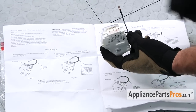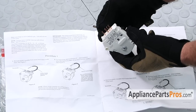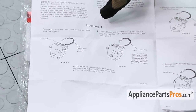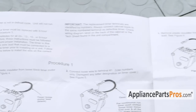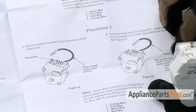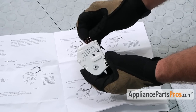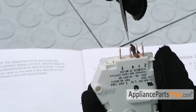Once you figure out which version you're going to use, that tells you which terminal to connect the timer motor wire to. If you have continuous run, it's going to tell you to hook it up to terminal 1. If you have version 1, it's going to tell you to push it down onto number 2. And if you have ours — version 2 — it's going to tell you to push it down onto number 1. Once you determine which one you need, you just push this wire down onto it, and make sure you push it all the way down with a small flathead screwdriver.